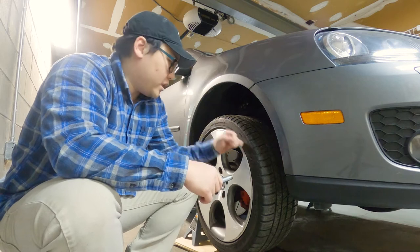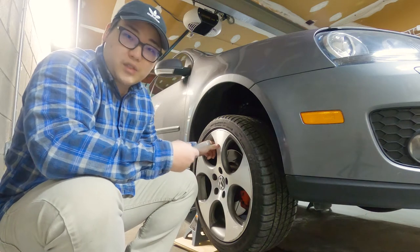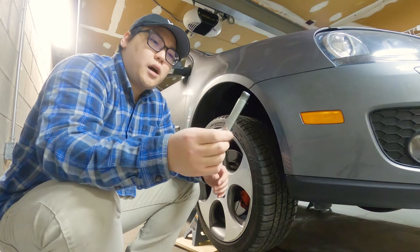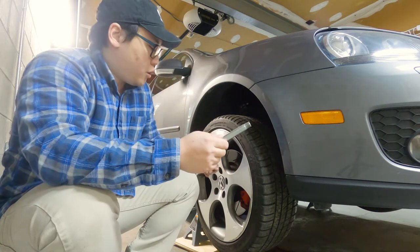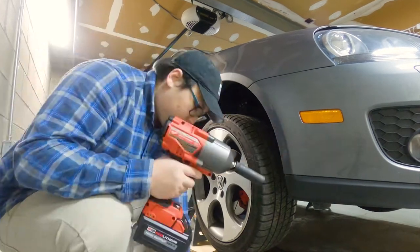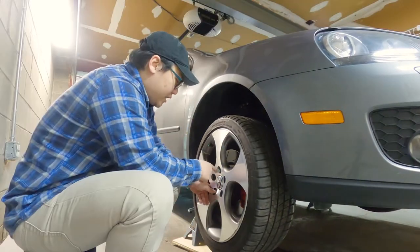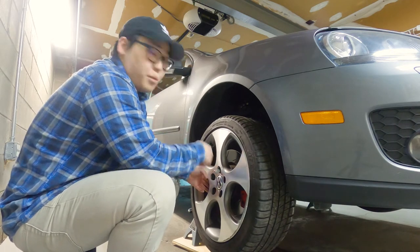So when you're taking your wheels off, if you own a VW, they tend to use bolts instead of nuts, so when you remove the bolt the wheel is just hanging there. If you remove all five of them the wheel will sometimes just drop on you. So this is a tool I highly recommend — I'm not really sure what it's called, but I think it's a wheel guide or wheel hanger. I'll leave a link in the description. It's a real nice tool so you can remove one bolt first, put this in, and then remove the rest so the wheel won't suddenly drop.